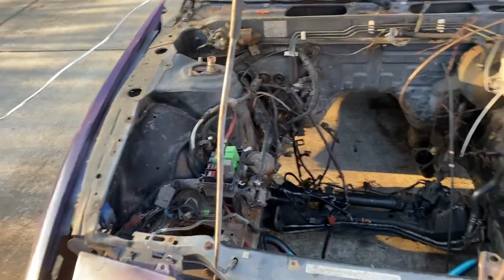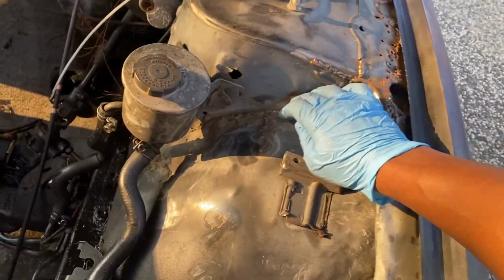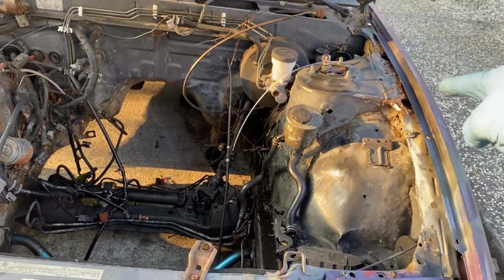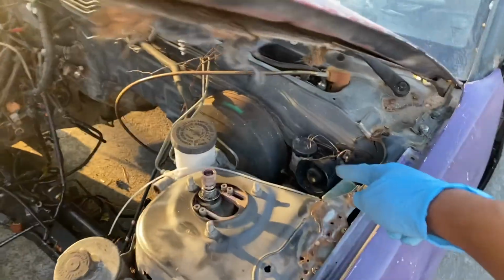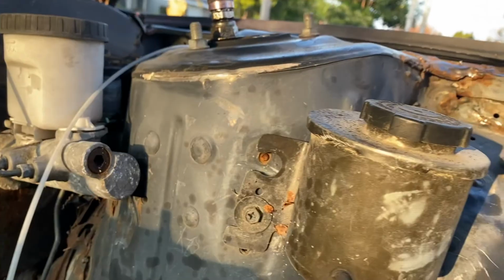But anyways, what I was planning to do is, there's a video with more skids, and a shout out to this one dude, I forgot the name of the company and the brand, but they do a bolt-in tube front. So what I was planning to do was cutting all this out from here, same thing on that side, cutting the whole front off and then doing the tube front. The only thing with that is that this side behind the strut tower will still need to be pushed out slightly, like very slightly. And everything that's bent in right here would need to be pretty much banged back in and welded.